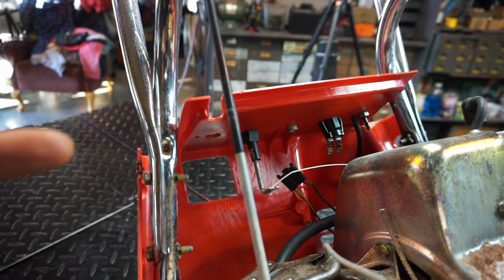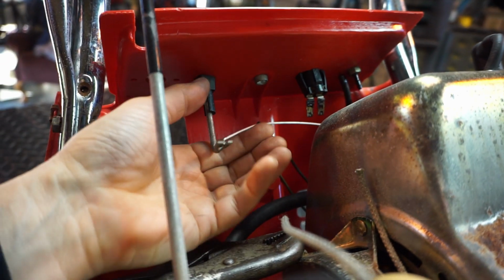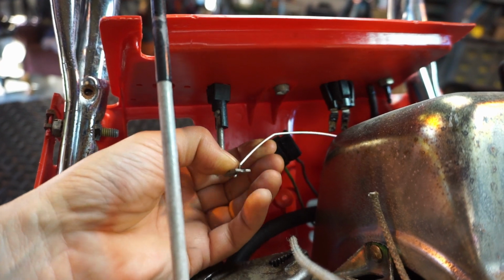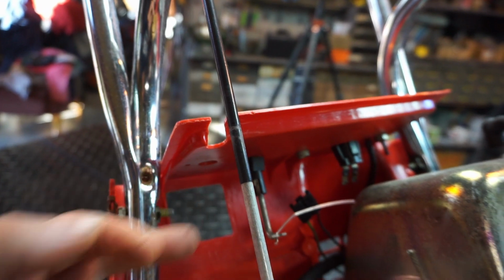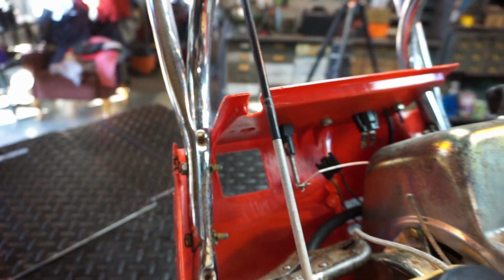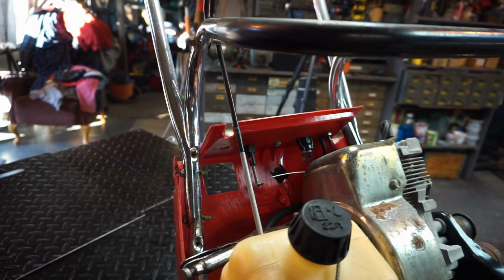All right, so the primer tube is off. A while back I pulled off the electric, which is a mess, right? We got to clean that. But to get this choke cable, this choke rod off, you have to bend it. I need two hands. You bend it a little bit and pull up. And then when you go to put it in, it's very thin. You're going to have to rebend it and then make an adjustment. Don't do it any other way. You'll probably break this thing and everything. So I need two hands for that, all right, to get it up through that Z-bend. So I'll do that and we'll pull it off. You'll see. And I got my vice grip over here. We had to cut that off on the end, right? Get rid of that because it floods up through here. It's just what you got to do.